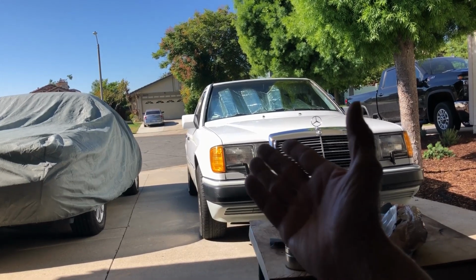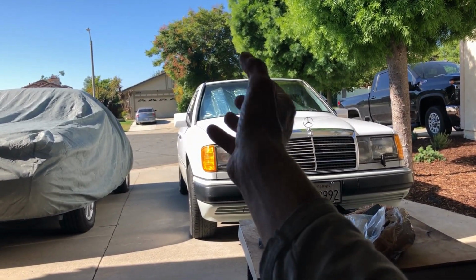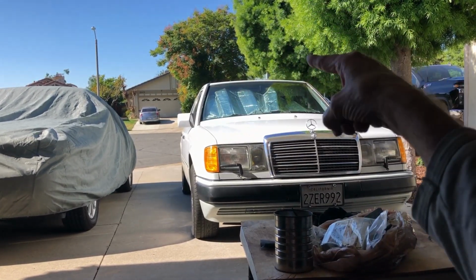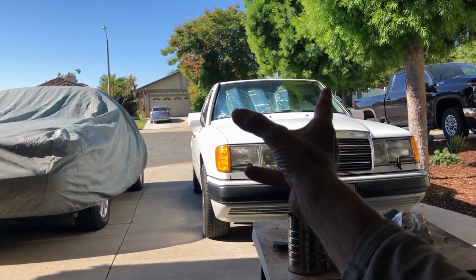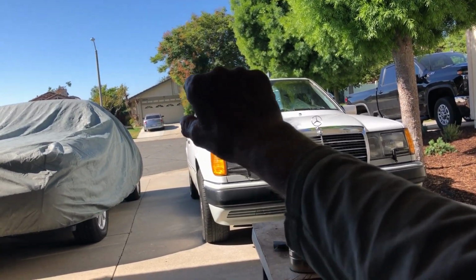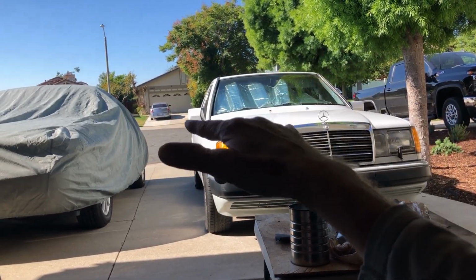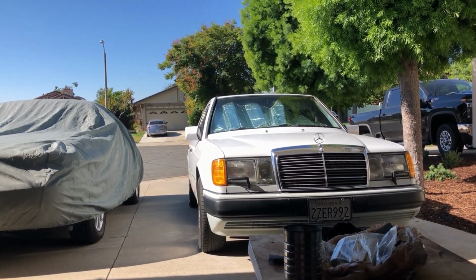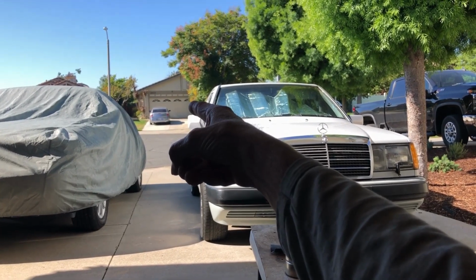But then I was at a kind of dead end. At the climate control unit, there's 14 pins on one side of the push button, 14 pins on the other side, all different colored wires. What are those colors? I could not find that anywhere on the internet. So I took the lids off of these connectors, and I made my own little color pin out. And Brittany Wright looked at that and said, oh, one on the passenger side is wrong.